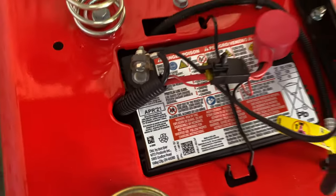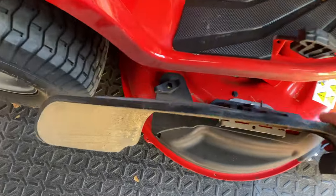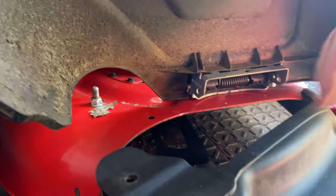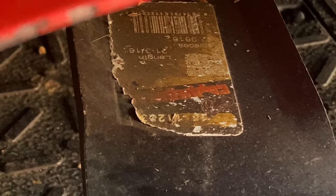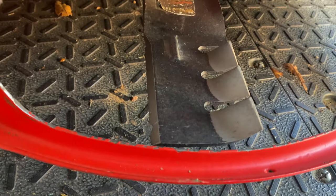I purchased this in the spring of 2020. Before we see if the battery is going to start it this year, I need to finish undressing the mower from its fall configuration. In my last leaf mulching, which was before Christmas, I didn't clean the mower as I usually do — just a quick blast from the leaf blower — and also left the mulch plug on. If there's one weakness to this mower, it's the mulch plug; it's a total joke. This is my third one, and this one's an aftermarket — they seem to last longer. My blades from last year: I usually use Gator blades, though through an Amazon mix-up I ended up with Copperhead blades, slightly thinner than Gators, but they performed well.